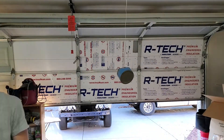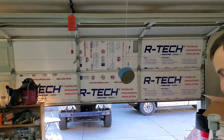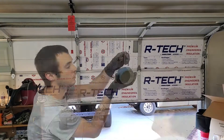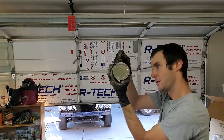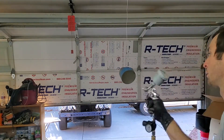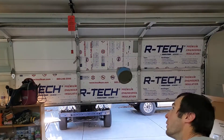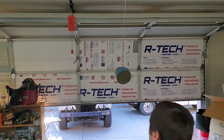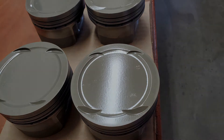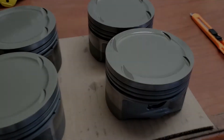When applying the product, apply a full even coat across the entire surface of the piston, then let it sit for about 20 minutes before applying a second layer across the top. The instructions state that 1 to 2 mil of thickness is proper for correct application. After the pistons are coated, remove the painter's tape while the ceramic is still wet, and use a rag wet with brake clean to wipe off any overspray residue on the pistons.